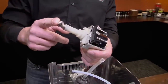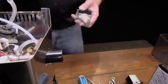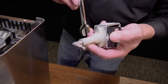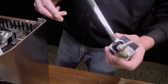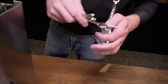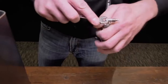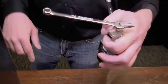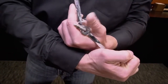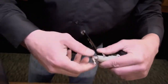The next thing we have to do is take this elbow off the pump so we can put it on the new pump. In order to do that, we need the 12mm wrench — you'll see there's a slot on both sides of the neck. We're going to force the 12mm wrench on there; it barely fits but it will go on. Then we're going to use either the 9 or the 10mm wrench. The 9 is really tight and it won't move. Basically we hold one wrench and break the elbow free on the neck, and once it's free you can spin it off with your finger.